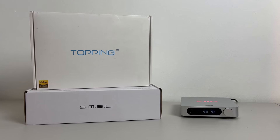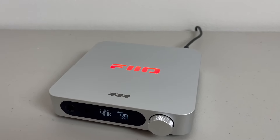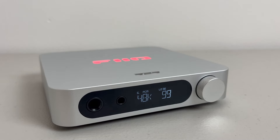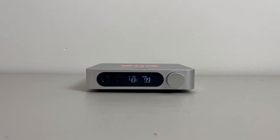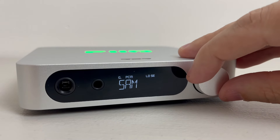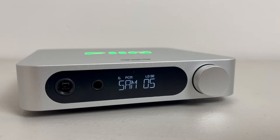In regards to other chip-based DACs in this price range from brands like Topping and SMSL, I feel those DACs are going to be a touch more analytical and detailed, especially in the upper frequencies, over the relaxed sound of the K11. Overall, those DACs can sound more neutral. Some folks try to peg the R2R sound as a warm, tube-like sound, but I think that's going a little too far, especially at this price range. But some people will hear the K11 and think it leans a little warmer over a straight neutral-sounding DAC like a Topping or SMSL. I tried both oversampling and non-oversampling modes and couldn't pick one as definitively better — that's always going to be based on your listening preferences and the gear you use. But I'm impressed that a sub-$200 DAC gives you both mode options.